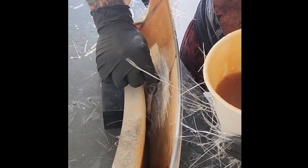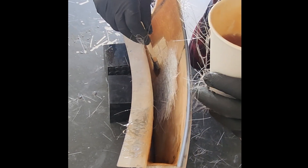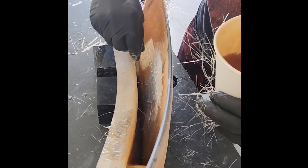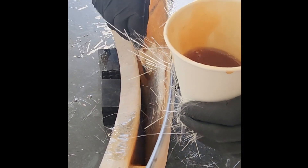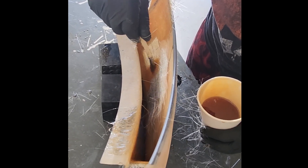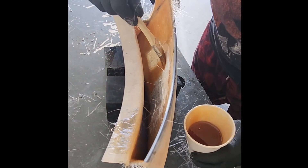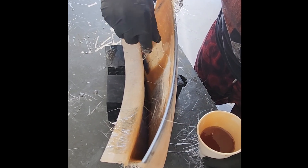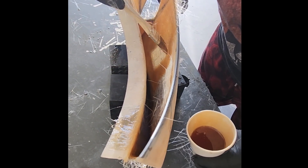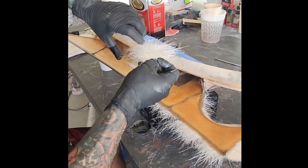You can see I'm using my chip brush here to really push that fiberglass down into that joint. And once I have it in place, I'm simply going to work the fiberglass mat and wet it out to keep it in place. Again, I'm trying really hard not to get around the parking sensor cutout, because anything that goes over that edge I'm going to have to remove to make sure the parking sensor mounting bracket can actually be installed.